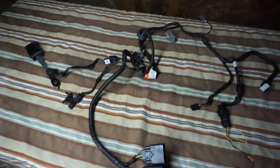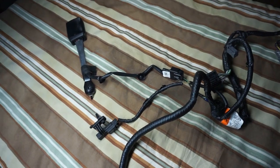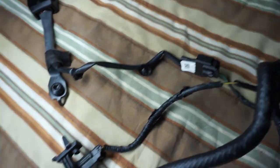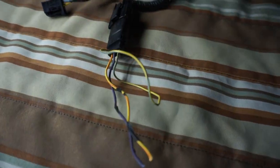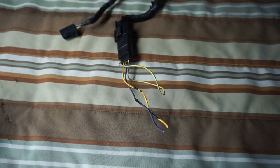After doing some research online I figured out that to keep your airbag light off and to keep your seat belt chime from going off, you have to take out the old wiring harness but keep the connector where the seat belt clips into. This I believe is the seat rail position sensor, and you have to keep the pressure sensor. This one is looped from the factory. These two wires you have to loop together with a 2 ohm resistor — that works best — and then it will keep your airbag light from staying on.